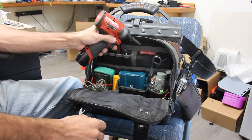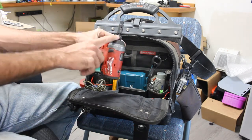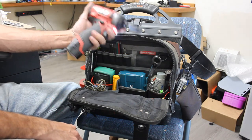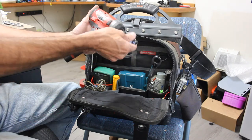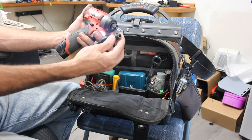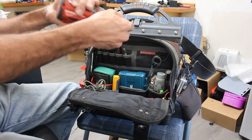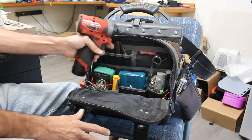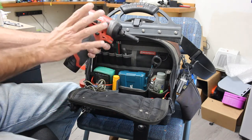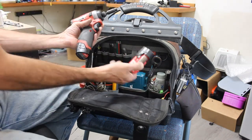This is the Milwaukee Fuel brushless quarter-inch hex driver impact driver. This is probably one of my favorite tools in my pouch. I keep a hex-to-quarter-inch adapter on there with a 10 millimeter / 8 millimeter flip socket, because I can use the 8 millimeter side to do 5/16 stuff. Extremely handy little tool — I really, really love this version of this impact. I also keep a spare battery in there.